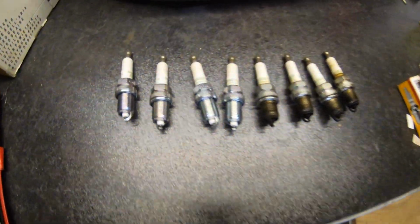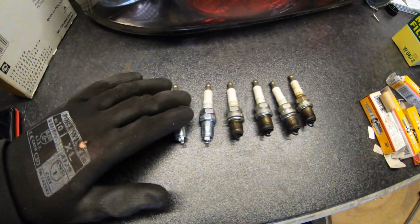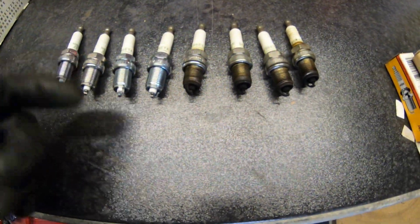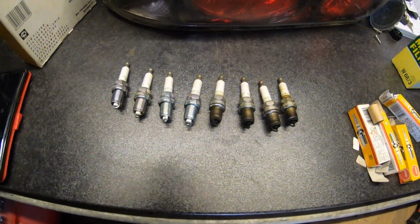And there we go with the typical side by side comparison shot. New and old. And exactly the same spark plugs as the ones I've got. They're the NGK BKR 6s. That's the 6 heat range. Yeah, they're identical apart from these are new. Again, I don't think these are overly worn, and these come pre-gapped. So I'm looking at the gaps between the new and the old, and they're the same. So they aren't exactly very worn. So either way, let's get these back in the car.